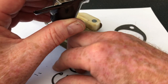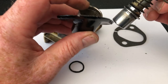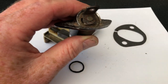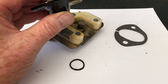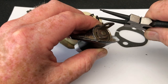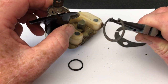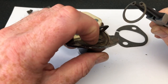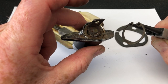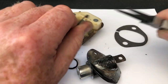There's a little circlip that goes in the top here, and that actually secures against a little ridge which you can just see on the inside. It's got to drop all the way down to that level before you get your circlip pliers - I have a pair over here. These will go in here such that you can then expand or contract the circlip, to then slot in the back here and hold it tight, so it's a body in its own right.